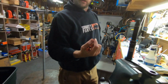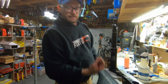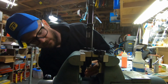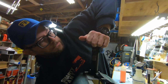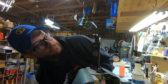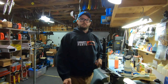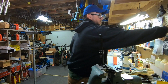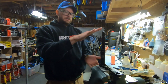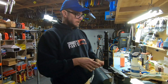I'm going to take an Allen wrench, and I'm just going to stick it up through the hole and basically activate the poppet as I push on this. So what I'm doing is I'm opening the valve, I push down. If I take it out, it stays down. If I push this in again, boom, pops up. Solid, doesn't move, boom. Test, it works. It's kind of a slick little thing because it's really nice to be able to just focus on the post. You don't have to worry about your bleed. You just get that done before you move on.